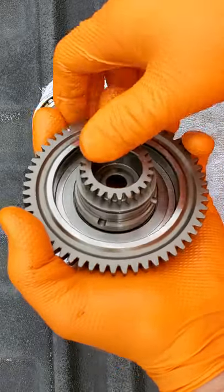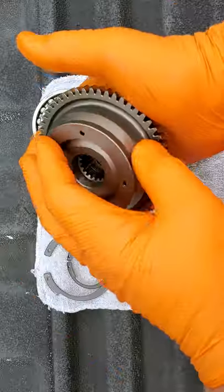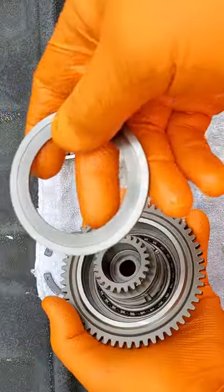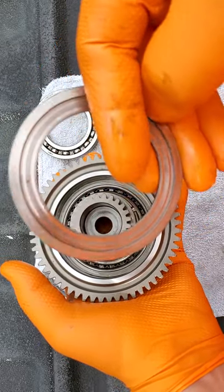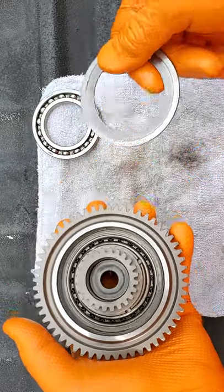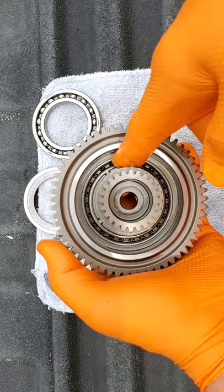This clutch, I think I've already got it locked up here unfortunately. You take the bearing out and you've got back here a backing plate — just knock it out real quick. This backing plate, you can see some wear and movement on it. I'll post some still images so you can see it better. This backing plate just keeps your sprag, which is down inside, securely locked in place.